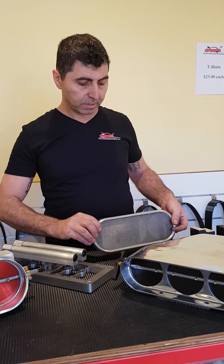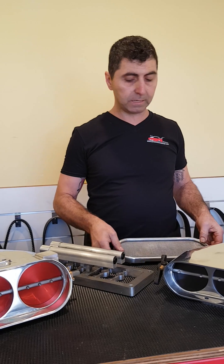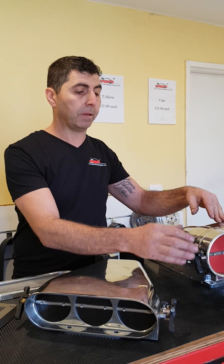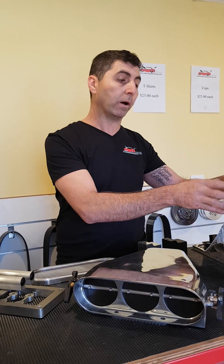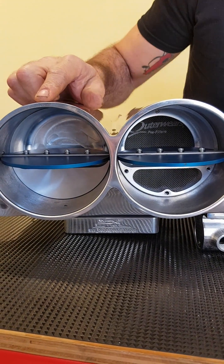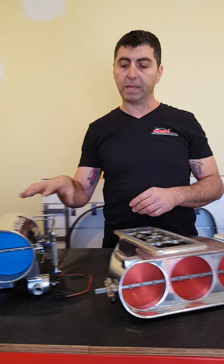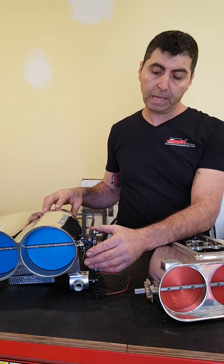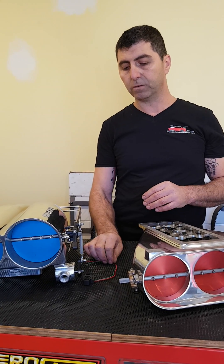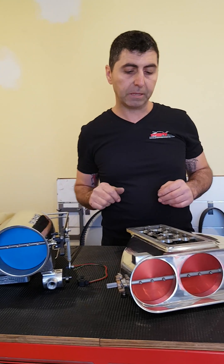Filtration. We also do billet framed filters which go on the front of our hat — that's the one for the bug catcher. We also do one for the bird, and then for the big and uglies and the shotgun we have a filter that goes in behind the butterfly so you can filter and won't see them. We also do blanks which will blank off the airflow from one or two of the butterflies. This one over here has already got the blanks and filters fitted — you can see this one's got a blank in it so no air will go through, and this one has the filter so all the air is filtered. What that does is it slows the air down getting into the motor, making the engine more docile and not so aggressive. It gives you a bit more throttle control and it's great for cruising cars, because otherwise if you had all of them open the engine would be very aggressive every time you touched the throttle.